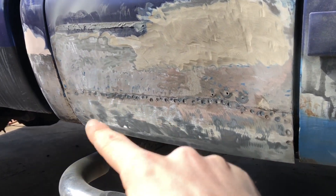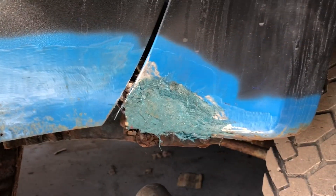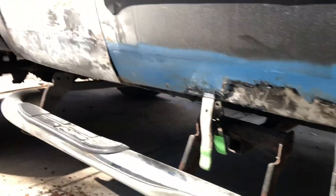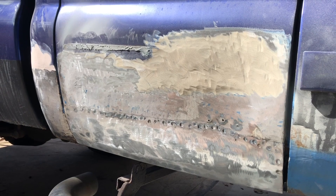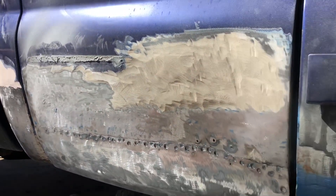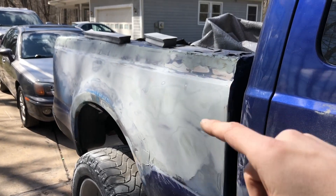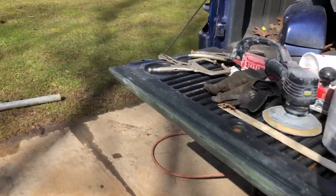Alright, just working on the next few steps here. I've got the piece welded in from my tailgate. I glued these pieces in because the welder wasn't working so well. I filled this rust hole — I was just showing you there's a big old hole in this front fender and I got that filled with some cardboard and fiberglass right now. I was able to sneak behind it and put my hand back there, which helped a ton. I'm gonna get that all cooked up today, get this piece entirely covered up, and hopefully get this other piece fixed as well. We've gotten a ton more done on the bed — really got all these dents out with just a little bit of silver coming through.